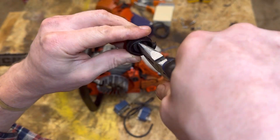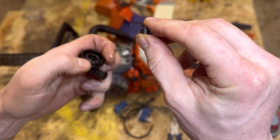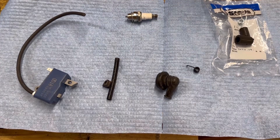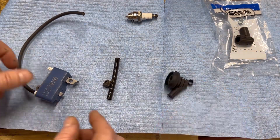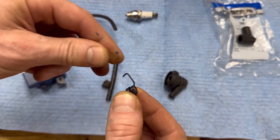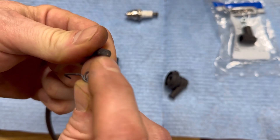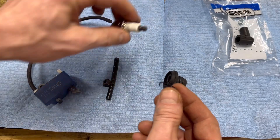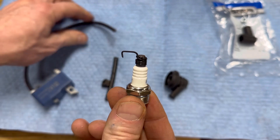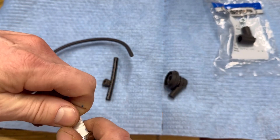Let's see if we can take out the little springer. Now I really hope this new coil works because that thing wasn't cheap. So we've got the plug wire boot and then the little terminal thing. Now that we've got it torn apart, we're going to reinstall all the new spark plug stuff onto our new chainsaw ignition coil. The way it works is that this little clip stabs into the actual plug wire and then makes connection on install — your boot slides over it. This clip is what slides over and makes connection on the spark plug.